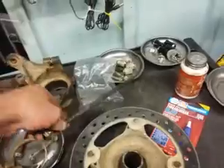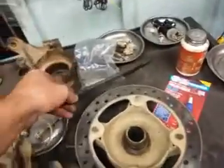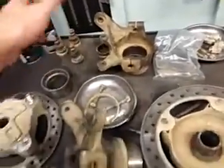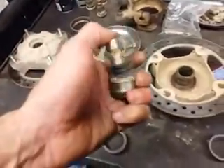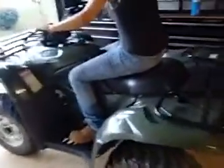I replaced the new a-arm bolt on the other side too, because this bolt is actually bent, so I replaced that. Ball joints are all bad, but one — one's not too bad, actually this one. I'm gonna hold on to that, might need it. Anyway, push it the rest of the way and put it in neutral — that way you don't hit nothing.